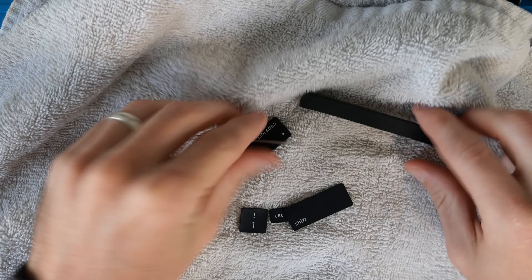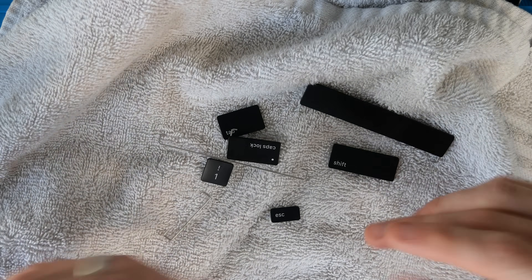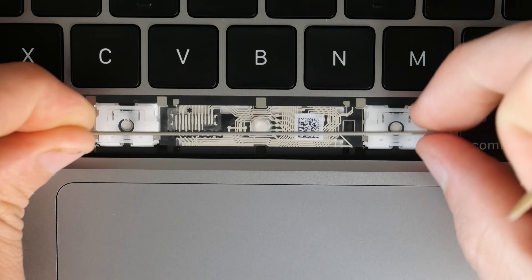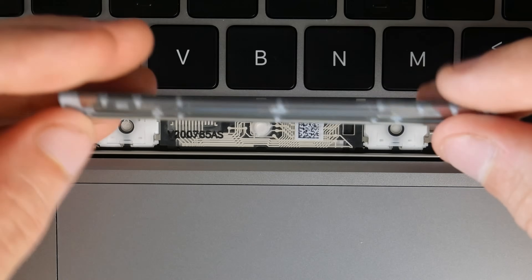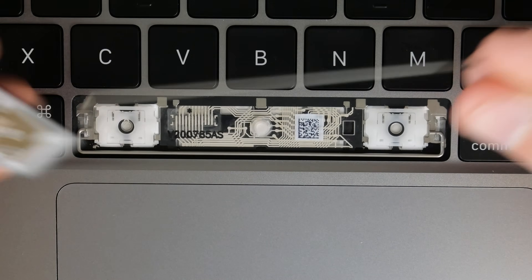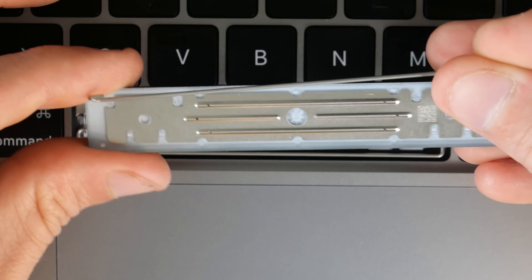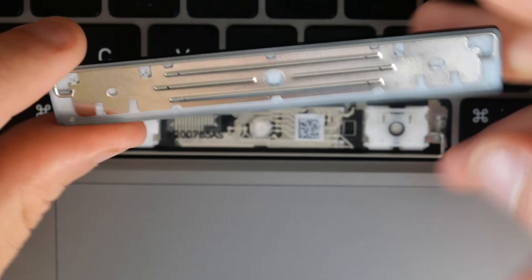Once the alcohol dries off your keyboard and the keys are dry, we're going to reinstall them — make sure you do it correctly, because you could damage a key cap or underlying switch and have to order a part off eBay or Amazon. First, reinstall the space bar: slide the wire support edges into the little aluminum holders, slide it in the middle, pull it toward you, and rest it down. Then take the key cap — it should have the top support already on it. If the top support got detached, orient the key (the top has notches that look one way, the bottom another), rest the top support along the edge, and press it down into the clips.